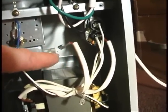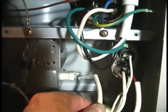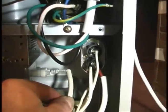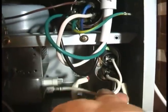One of the ways you can test the high voltage transformer is you can start it and test to see if you have power at the leads, which just go on the side of the magnetron tube. One lead goes up to the capacitor. So if you have power at these leads, the transformer is good. If you don't have power at these leads, then your power supply is bad.